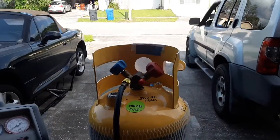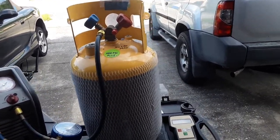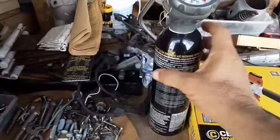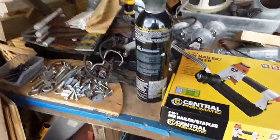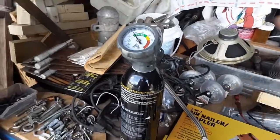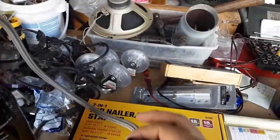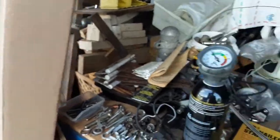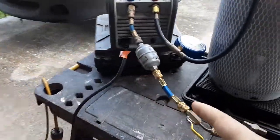Eventually, if I do get into my own business or something like that, then I'll obviously have different tanks and everything. My next trick is to actually see if I can recover from these type of cans that come with the little valve that goes on your car. So far what I'm doing is I pull a vacuum on the car, hook this up, let it suck in the refrigerant, and then I recover from the car. But I think when I get to school I'm going to see if I can find the male piece tubing with that fitting from the car, and then just braze another fitting that will fit my recovery machine lines — the quarter-inch ones.